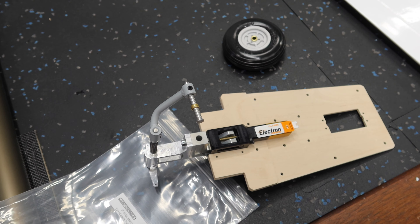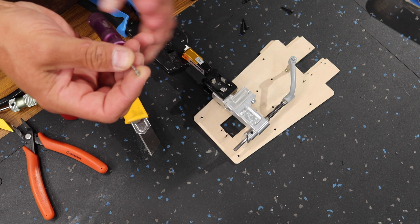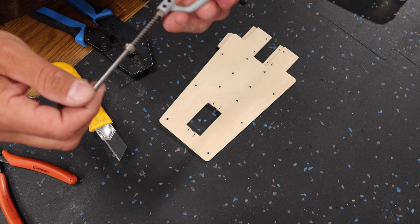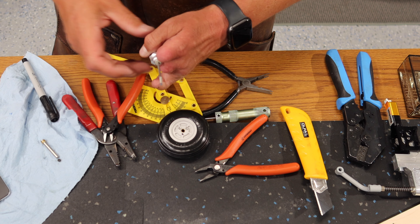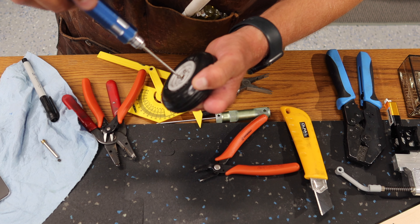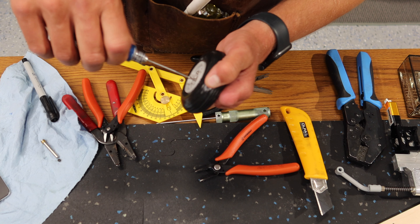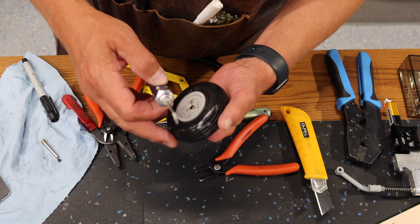First step in the rear tail section is to take all the bolts, nuts, and screws off the rear gear and make sure we blue Loctite everything. We're adding flat spots to the main collar, doing that on everything for this tail wheel including the other clamps - we want to make sure nothing moves. I stress this with all my builds: it's very important to check every bolt and nut on your aircraft. Manufacturers do not install Loctite. I can count on one hand the planes that have had Loctite installed on the gear parts - actually I can count one aircraft. If you don't do it everything will come loose over time and makes for a real maintenance nightmare.